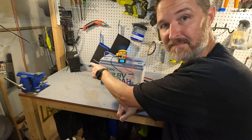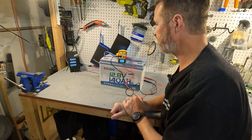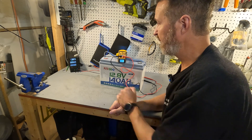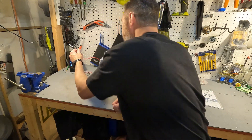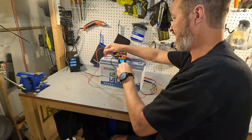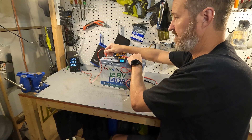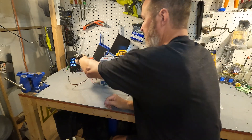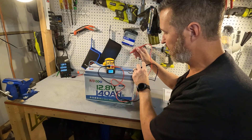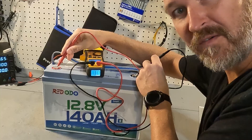What I'm going to use is my benchtop charger over here. We'll just turn it on — it's set for 13.6 volts, that's perfect. Let's go ahead and grab these leads and touch it to the battery for a second. There we go, it started to charge. Now let's check the voltage of the battery again — and it is 13.17 volts. Perfect.